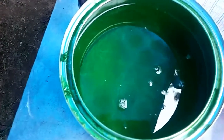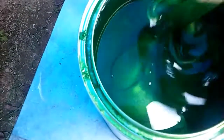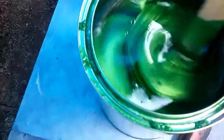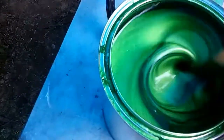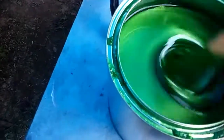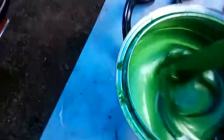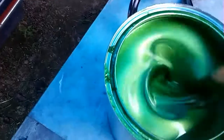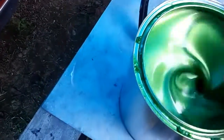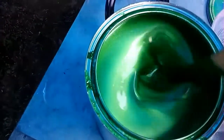Today I'm going to use my 1.8 that I sprayed a base coat with. I'm going to go ahead and stir this paint up to let you see. As I stir it up, you see how it's starting to come up — this thing is full of metallic. Just full of metallic. It's pretty paint. It amazed me how something can go on with this much metallic in it, but if you've got the right equipment, it doesn't make a difference. So today I'll be using my 1.8 high solid spray gun to see if it's different as I spray the inside of the hood and the wiper area, and I'll be posting that later on.